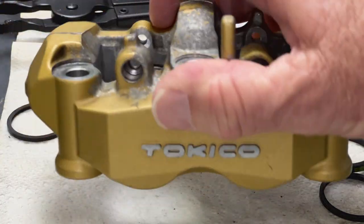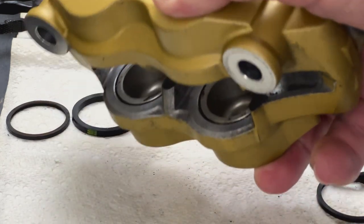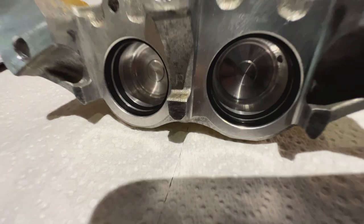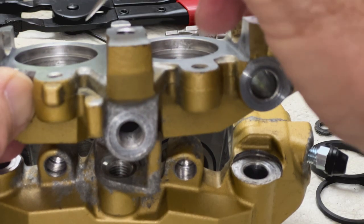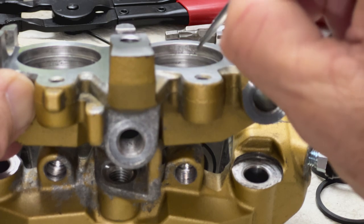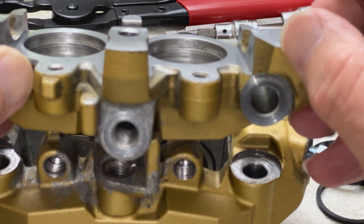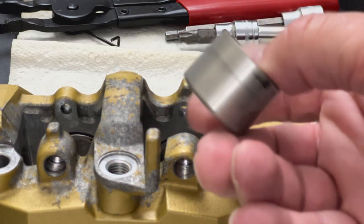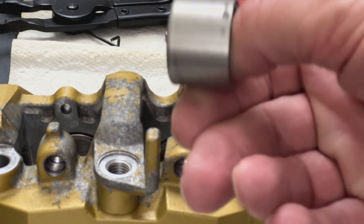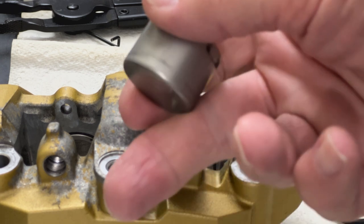This one's already done — I'm not going to make it look pretty, I'll just leave the outside alone. What I've done is put new seals in the caliper. This is the left-hand caliper, and right in there we had the corrosion. This corrosion was pushing the seal out and jamming the piston. Here is one of the pistons — just got to polish them up. There are no gouges or grooves or anything like that, so I've already polished up this set.